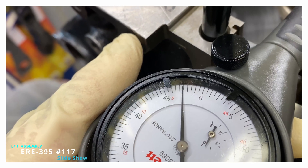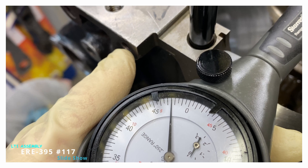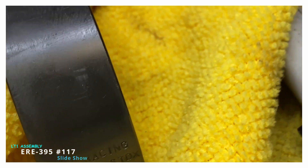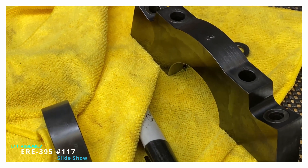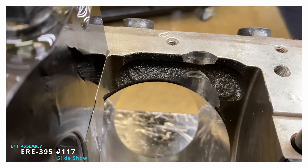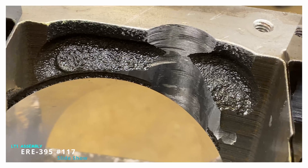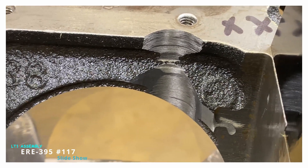I think what I have is X-size, one-over for the mains. That's the King — see the standard with an X. That gave me generally 0.003, 0.0027 for the main bearing clearance. Worked out nicely. The block was pre-clearanced by Clinton Auto Machine — they do a real good job — and I make it just a little bit wider by hand.